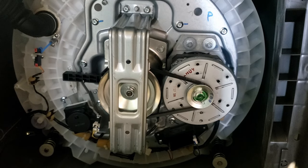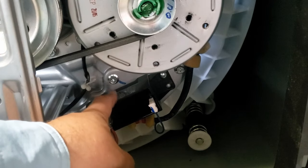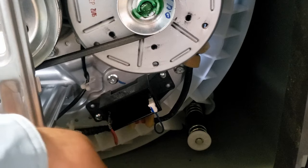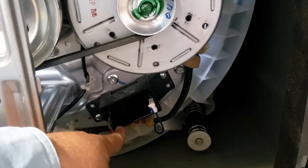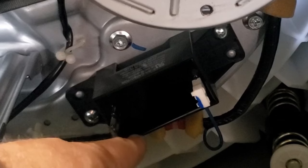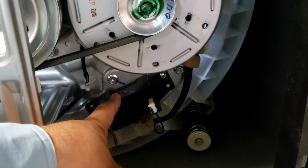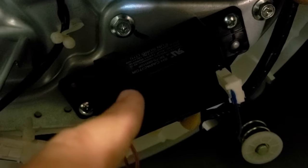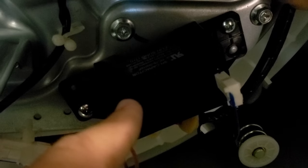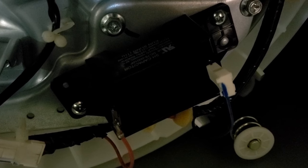One of the first areas you want to look at is the capacitor. The capacitor has two wires going to it — a blue wire and a red wire. I have seen situations where the wires will be disconnected or severed, so you want to tug on the wires just a little bit and make sure they are plugged in properly. Also check the capacitor housing — if you notice any part of it has bubbled out or gone outside the casing, the capacitor may be bad, so make sure it looks intact.